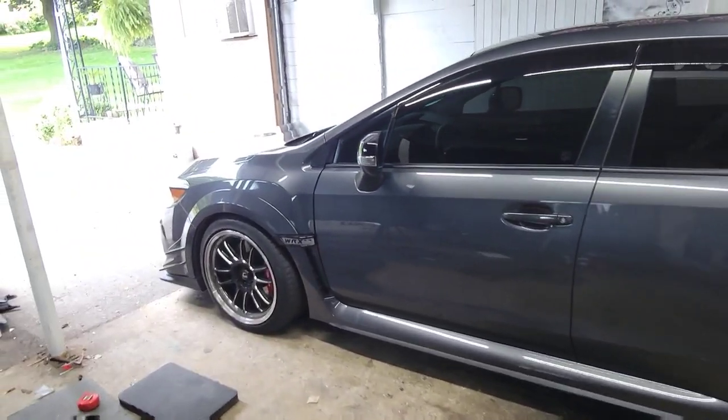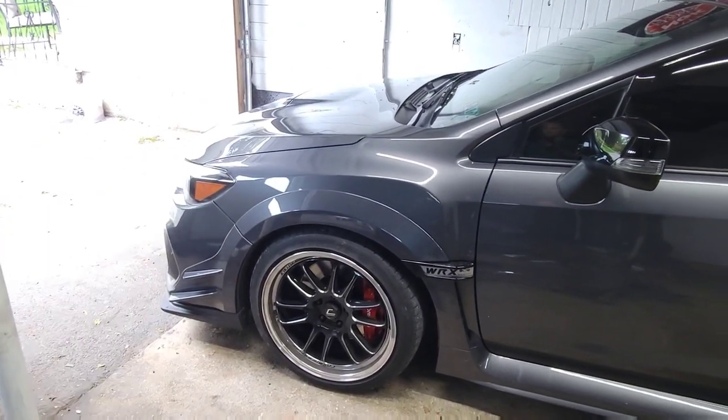I got the rear up a little higher and the front down a little lower — the front's still sitting slightly high but I'm exhausted and I'll sort that another day. I ended up readjusting the height three full times total: jacking the entire car up, removing all four wheels, readjusting all four coilovers, reinstalling wheels, taking a short drive, and repeating. Very annoying but I wanted it dialed in. It's now leveled out close to where I want it — barely rubbing in the rear. I rolled and trimmed the fender but there's little else I can do without removing spacers or fender flares.